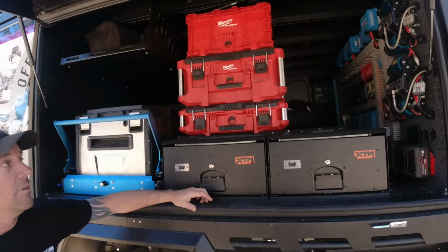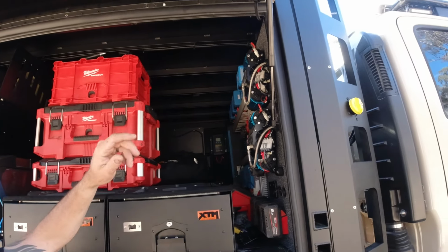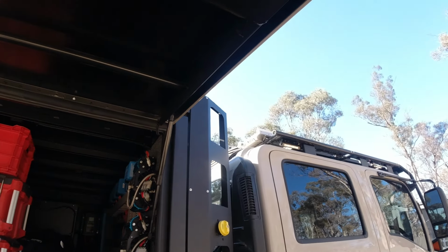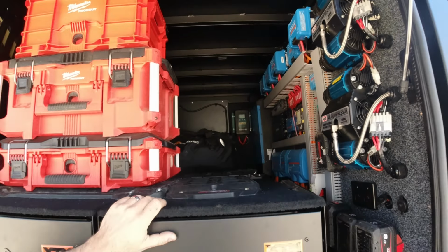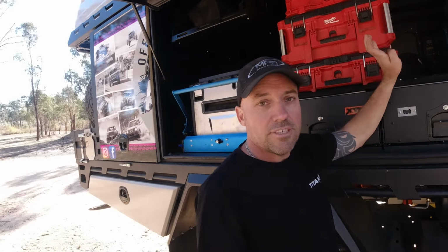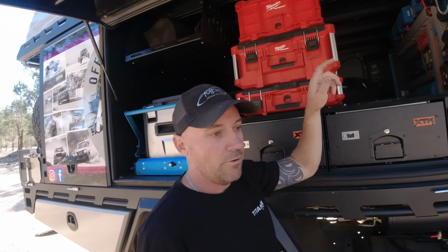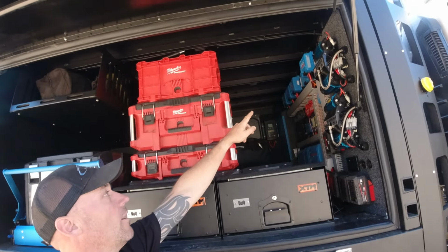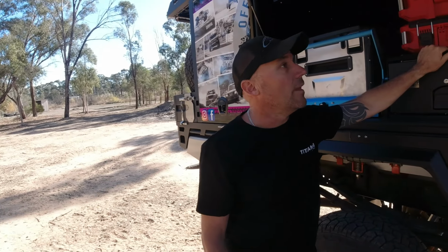Wow, that's pretty big. And then we've also got, on the roof, a Starlink Mini. That's run by the Outback Comms system you can see in there. Up the top we've got 4 DC-DC chargers, and we've got two 200 watt solar panels on the roof. The one on the far right is the MPPT to run the solar.